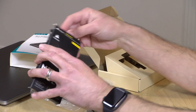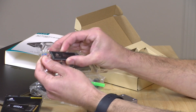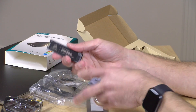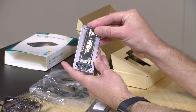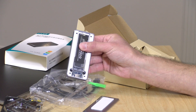Then I'll take out the drive here and see what we've got. Again, this is that MP300 we reviewed a few weeks ago, and you want to make sure you're grounded when handling electronics like this. This is an NVMe drive, and we're just going to get it installed. I do have to get the screws out to screw it down properly, but it just goes in like so — you put it into the slot there, push it down, and then get that other end screwed in. Let me get this thing screwed back together, and when we're done, we'll boot it up and see how it performs.